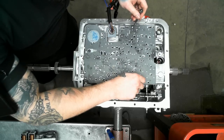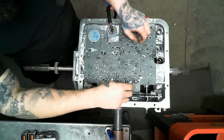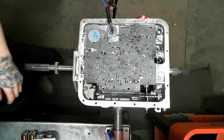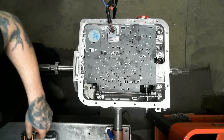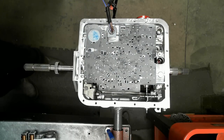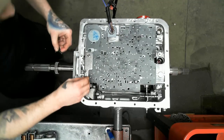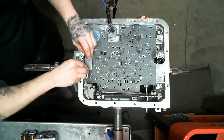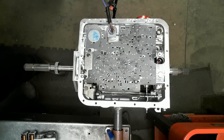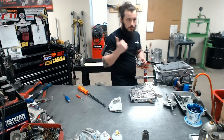A couple bolts just to help keep it in place, make sure we don't get any cockeyed gaskets. It's similar to, a little bit more complicated than, the pump alignment. You're just, in essence, making sure no cross leaks, no tears, nothing's feeding another clutch set that shouldn't, causing a bind up, etc. So merely those couple bolts that you put in will save you a lot of stress. And then another point of interest, I've also set up Gene's second accumulator, or Alan's second accumulator here, to suit what I think he ought to have.